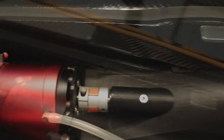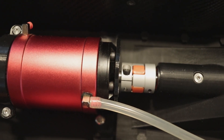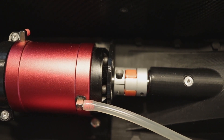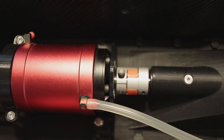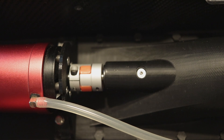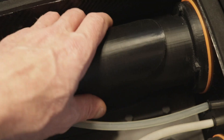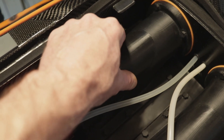There's the motors, and that's the coupler. If you're wondering, that is kind of the best coupler I've found — with a little rubber or plastic insert in the middle that takes off a little bit of vibration. I haven't put any oil in yet, but I'll do that before I go down to test. It's going to get filled with oil, and these basically just clip back on. It clips around the engine mount and onto the shaft pipe — no wobbling, no rattling, so that's good.